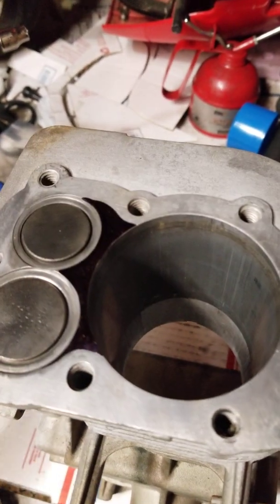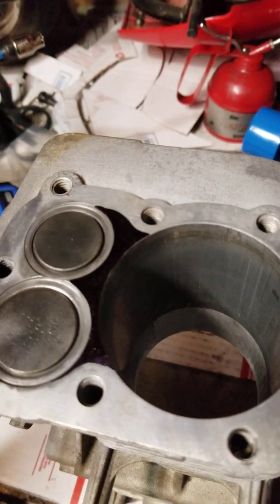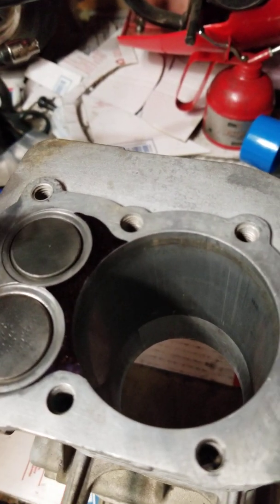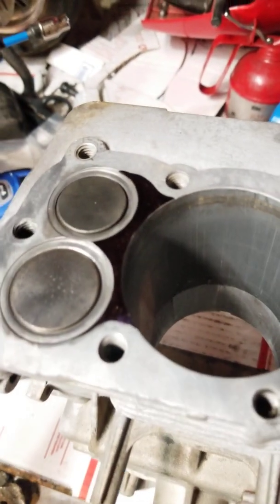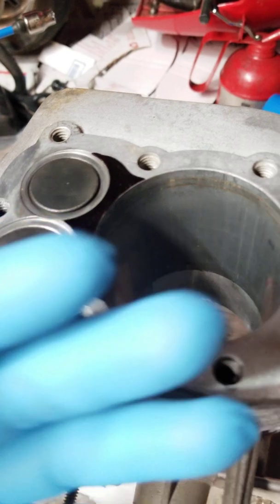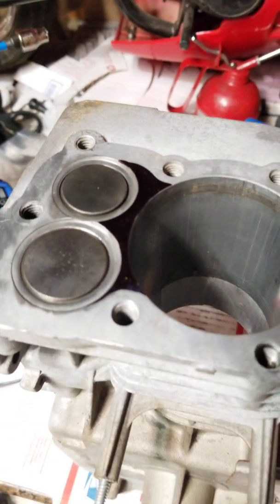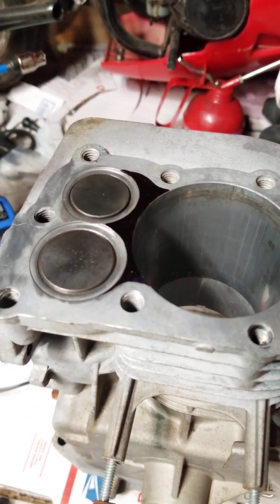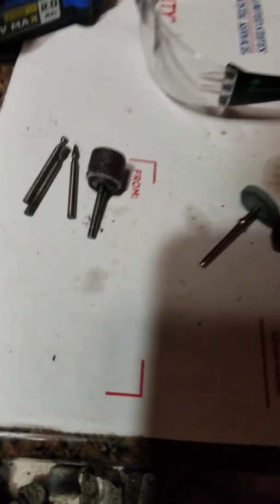You've got to figure that when the gas is coming in, the piston is not quite all the way at the top. People like to say that if the piston is all the way up and you've got the eyebrow shaved, the piston is going to create a wall — but no, because the piston is still on its way up by the time the charge gets on top of it. Anyway, that's my two cents on that.